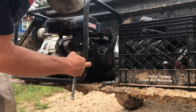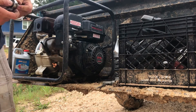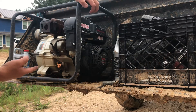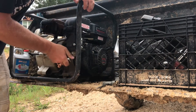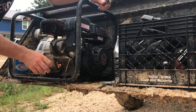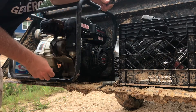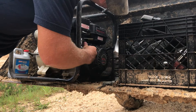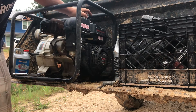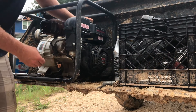We've got a plug on the bottom of the carburetor — there's one to actually take the carburetor bowl off down here. I don't really want to pull that one; I'm going to pull the one on the side, which is a drain. We'll just let it drain out a little bit of gasoline — if there's water in the bottom of that carburetor, maybe it'll clean it out.